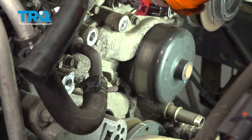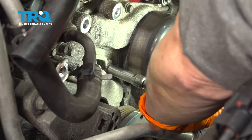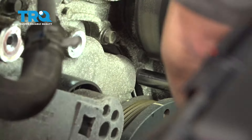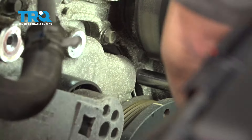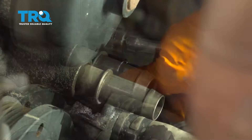Now we're going to loosen the water pump — all eight bolts, and it's a 10mm socket. Get a three-eighths extension or whatever size ratchet you're using and break them free. There are eight total. Just pay attention because it looks like the same bolts but some aren't attached there. You need the extension for down below. There's one way on the bottom — it literally comes to a point like a triangle. You can always use the new water pump as a reference.